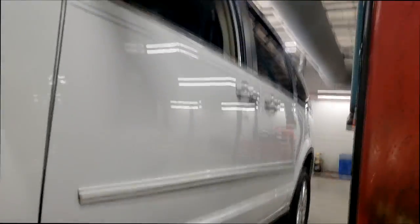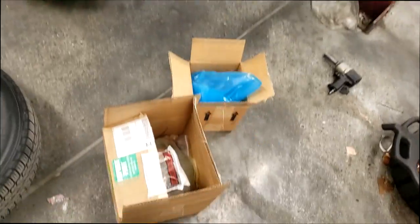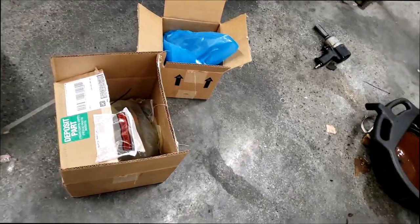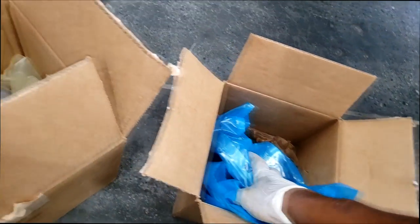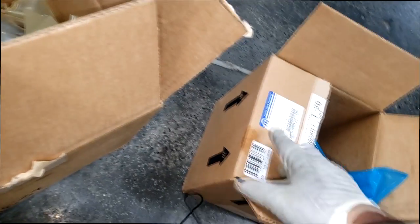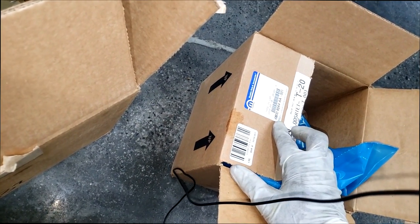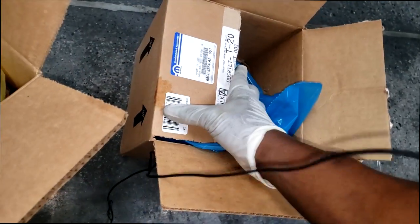Welcome back to the channel. You can see this Chrysler Town and Country, I believe a 2014 model. I get here this morning and the parts for this car are laying in my stall. What you see here — I recognize this is a torque converter, and this is a front pump. These are the parts. I don't see any gaskets or seals; maybe I have to go get those. This is a transmission front pump. The problem I'm addressing is P0740 — torque converter clutch code. I'll put the specific name in the description. These are the parts required to repair this car and address that fault code.